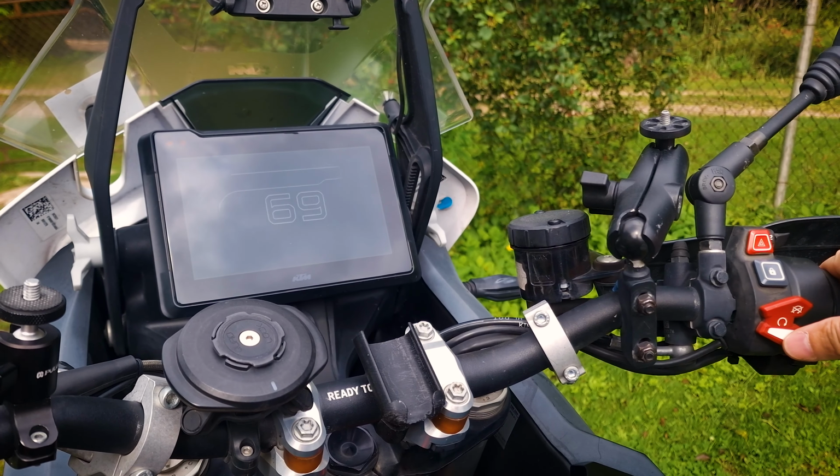The most interesting thing about this bike is that theoretically, you can remove only half of the tank. But the fuel neck is fixed on screw clamps, but the tank vent, which goes on top, on disposable clamps. So you can remove it, but you need to have new clamps on hand. I didn't have them, so I removed the whole tank.